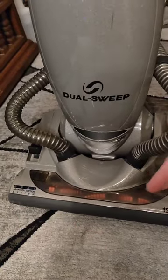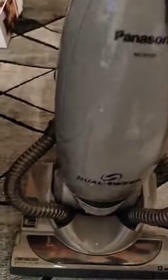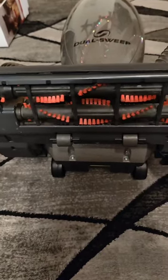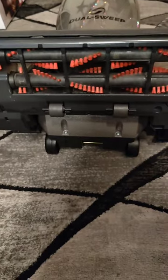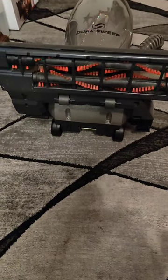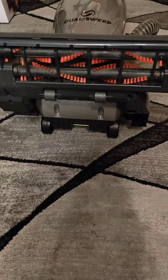They kind of sit at an opposed angle here and here above the brush rolls. We'll recline her back, and as you can see, we have a double counter-rotating, yes, counter-rotating brush system. Pretty stiff standard nylon bristles, open chamber design to allow for maximum airflow, and as you can see, they're numbered from a service shop, I do believe. I can't speak for hair tangling or lack thereof. It's two men in an apartment, so there's not much long hair to be had. There is pet hair, seems to handle that just fine.